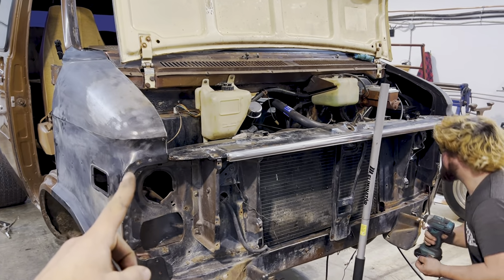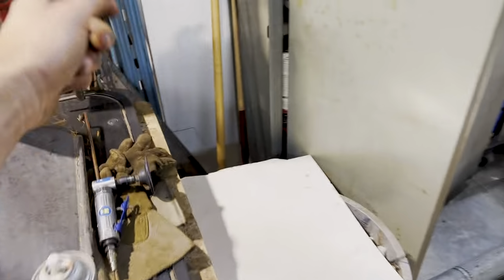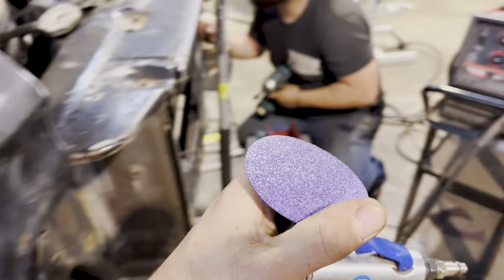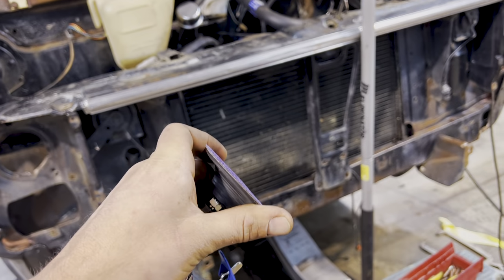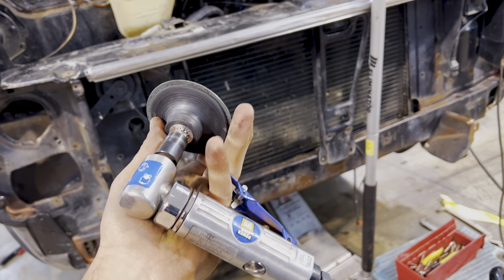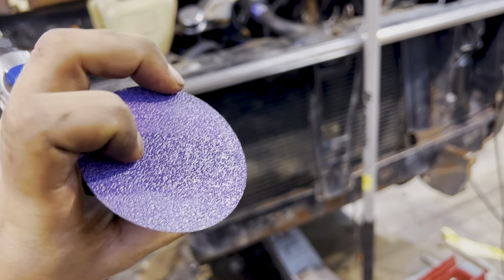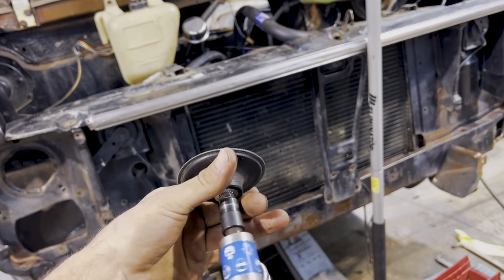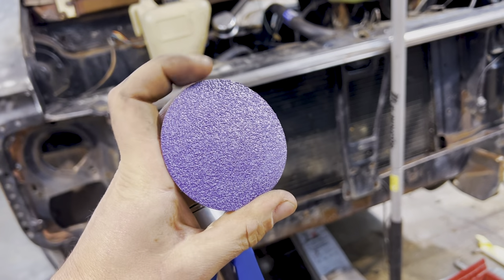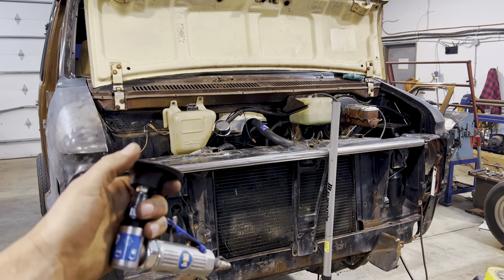Now I'm just gonna use some 60 grit roll lock on a 3-inch angle die grinder. There it is, 60 grit. The discs I like the best are 3M Cubitron discs. If you look them up, you will find that they are very expensive, but from my experience, not at all sponsored by them, these are the best discs out there, and they will last 3 to 4 times longer than any other disc that I've personally tried. So they are worth the extra money. They're probably almost double the price, but they cut and they stay sharp. So I'll probably get every single spot weld down with just one disc, we'll see.